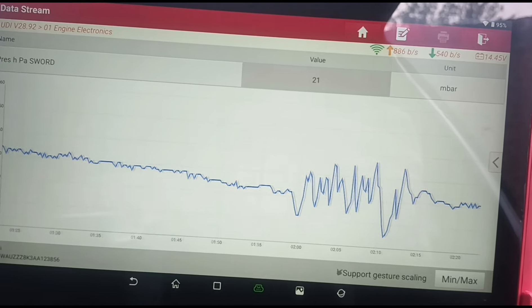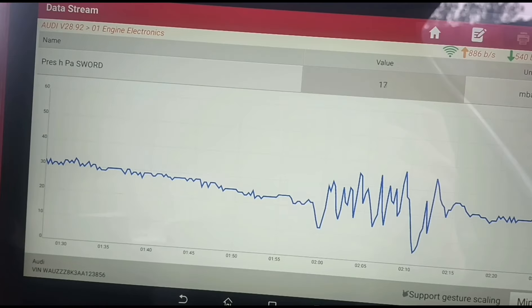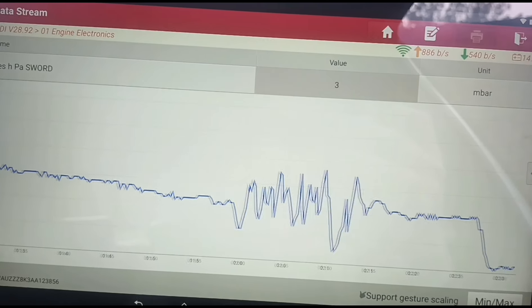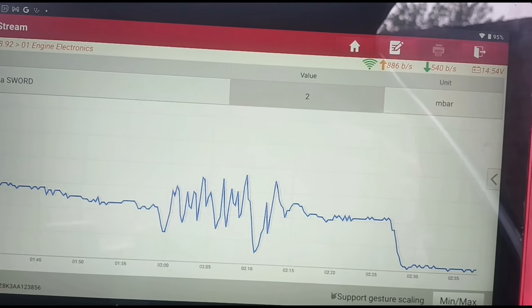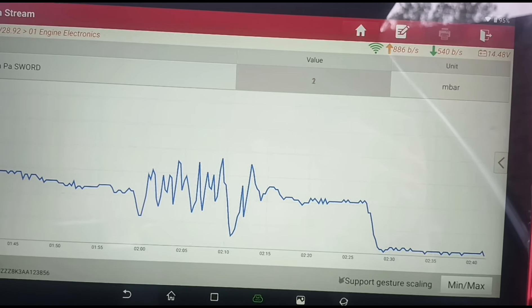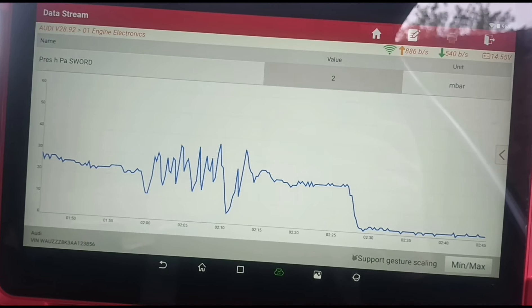It's actually coming a little bit suspiciously low this one — about 20 millibars, that's quite low. But we've got sort of 2–3 millibars, so there is some resistance. It looks like we have got a working DPF in there, because I don't like when they go to zero really — that can sometimes indicate that the DPF is cracked.